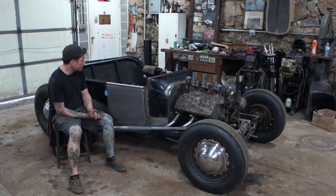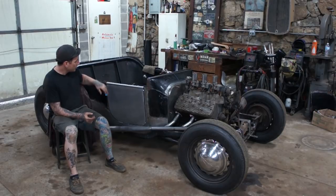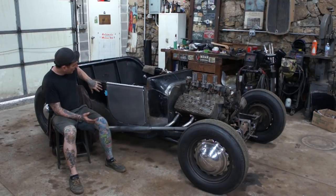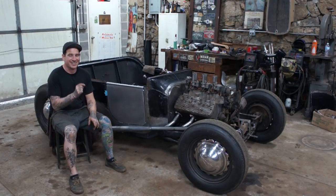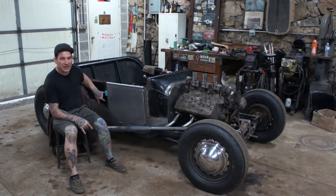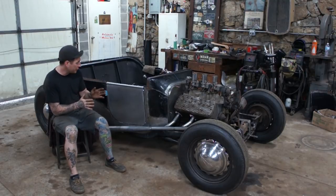What I'm going to do is take out some of these spacers that I have put around the doors. You can see them taped in on this side, and I have some more tape on the other side. And what we're going to do is put the hinges in the back here. There should be just about enough space because I put these 3/16 inch spacers all around the door, so there should be enough space that we can slide the hinge in the back here, and that will get it so that we can fit it in.